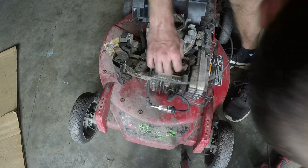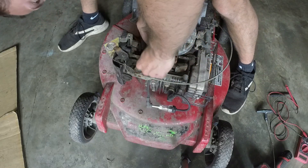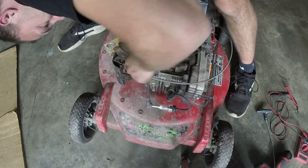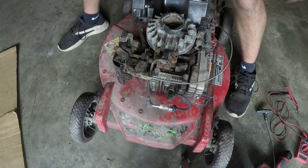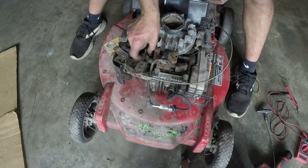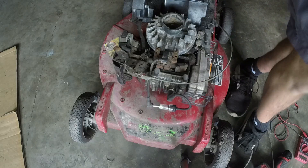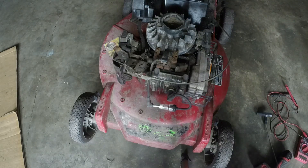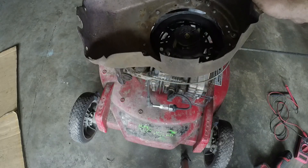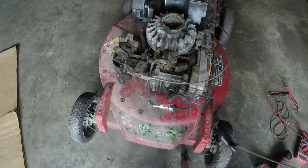So I'm going to put a pull rope on it. I've got to plug this wire back in — I knew it was coming, this is coming back off anyway. For the pull rope: all you've got to do is pull it out as far as you want, put a screwdriver in it, cut off the ends, measure the length of the same rope, keep the tension spring on, push your new pull rope in, put your end on, wind it back, and you're good to go.